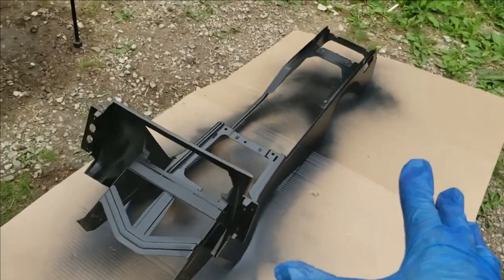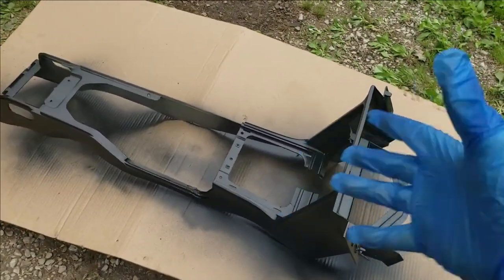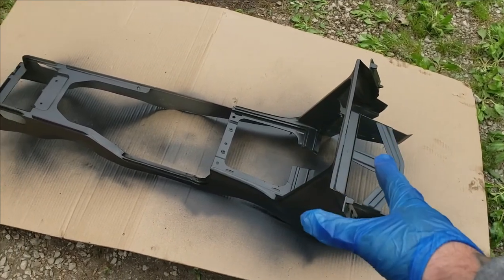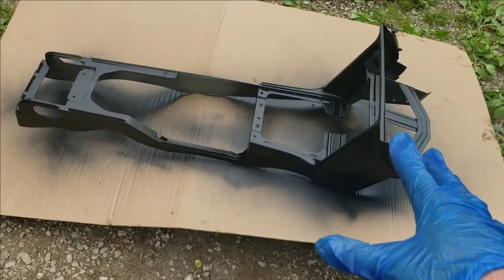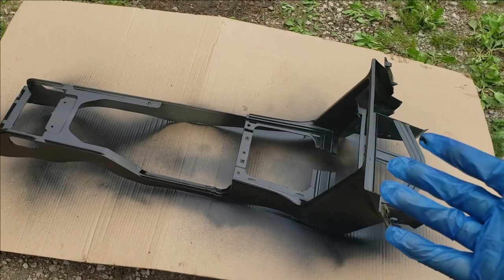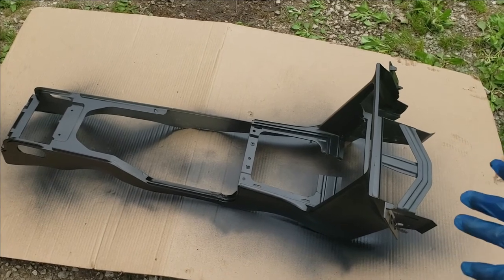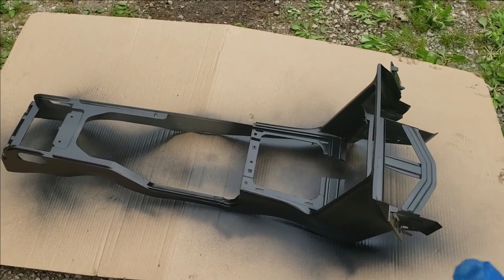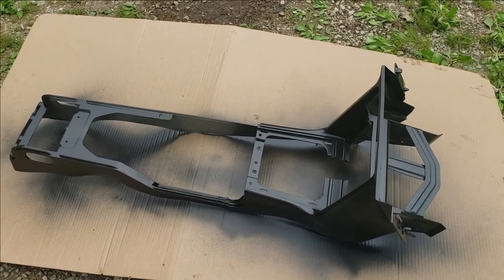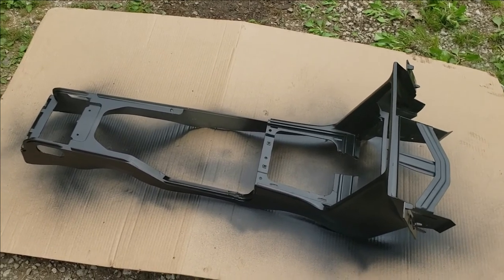All in all, I'm very happy with how this console turned out. If you're doing this inside your car, just mask the carpet off and everything you don't want painted. But if you take it out and paint it like this, it's a whole lot easier — less masking, and you can get to every spot extremely well. I recommend taking your console out to paint it, but you can do it inside your car. I've even painted dashes inside cars before. There are plenty of videos on my channel about this subject, including how to paint dashes — check out my Dupli-Color playlist.